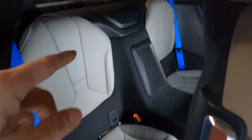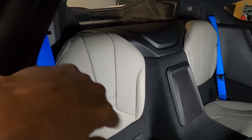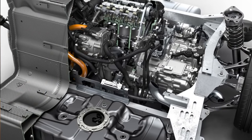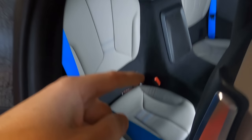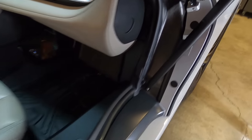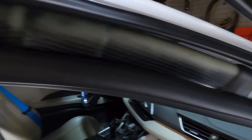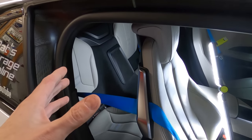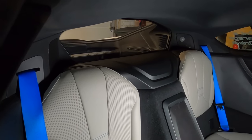Here is the rear of the car — so where the small back seats are located — and of course our engine compartment is in there. Some folks said, what if you cut an access hole in this area in order to access that side of the engine? Well, this car is made of carbon fiber. It's a carbon fiber monocoque, and this is everywhere, including back here and under the seats. The entire life cell, as they call it, is all carbon fiber. If you actually cut into this, you'll compromise the integrity of the car. You don't want to do that, unfortunately. However, a nice access panel would make it super easy to access that side of the engine.